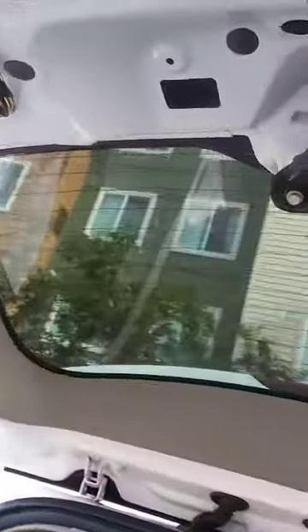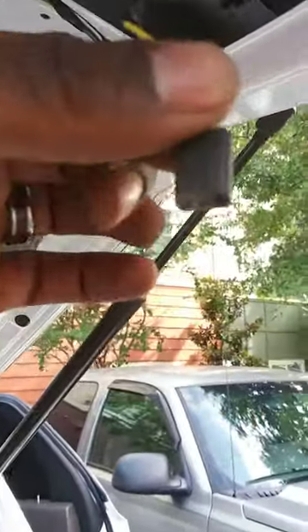There's two little lights on your tailgate panel. These connectors here, you have to remove them. This little clip there — just squeeze that in and release it. Both sides. Here's your panel, they just pop out. It's got these little push pins. I got one damaged here — I guess whoever installed it just smashed it. Got these clips here all the way around, they just pop out.